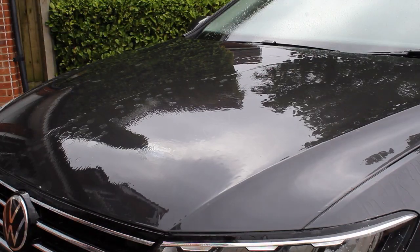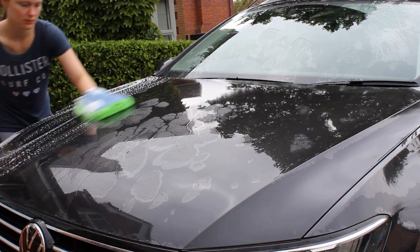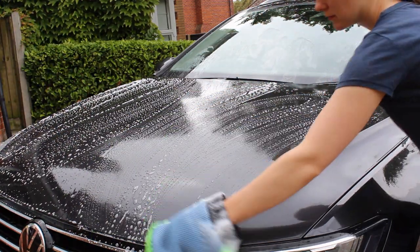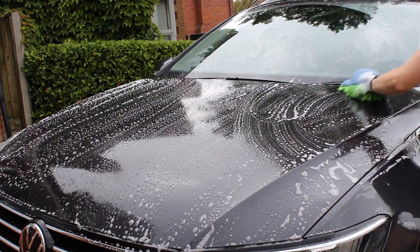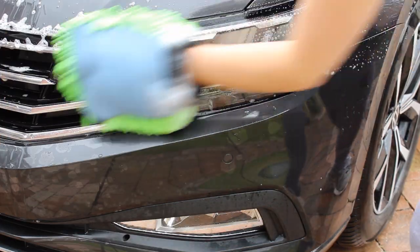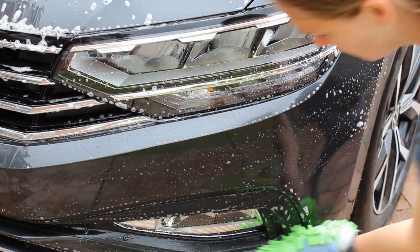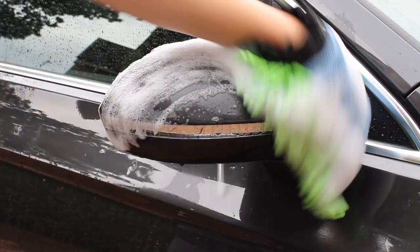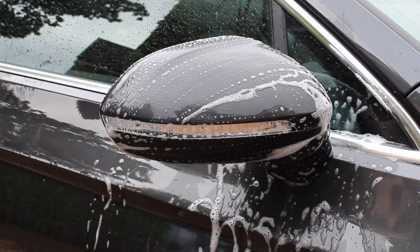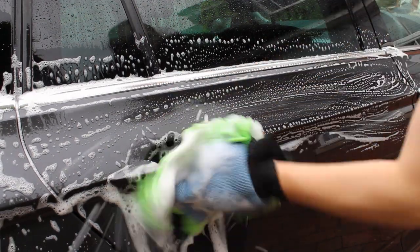After power washing and completing the pre-wash stage, I moved on to the contact wash using Garage Therapy decon shampoo, just to reset the paintwork. There wasn't any protection on there, but it would give it as deep a clean as possible before applying protection. I used around 30ml of product in a 20 litre bucket — an economical ratio that also provides really good slickness and cleaning ability. This product foams up really well with great stability, so you don't have to keep reviving the suds throughout the wash.